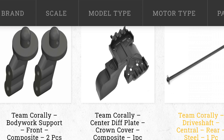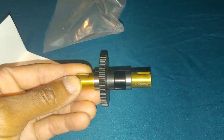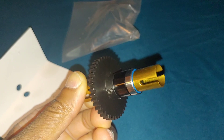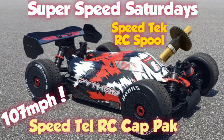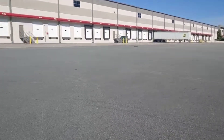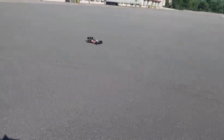I also have a spool for this from Speed Tech RC — it's a 42-tooth spool. They're one of the few companies that make actually good, durable spools for the Team Corally cars. Don't be fooled by other spools out there. I have a 35-tooth on my Python, and I'm getting about 105 or 106 miles per hour still running the stock electronics — well, I did put a Max 5 speed control in there, but the motor is still stock running 6S.